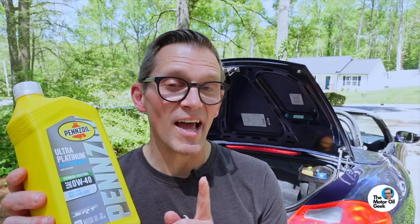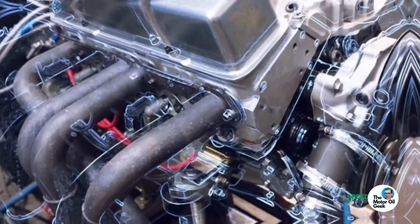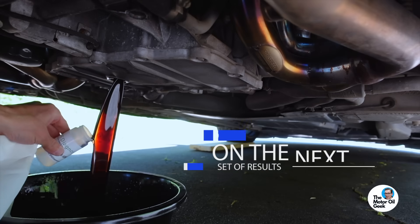Esters are typically good because they have polarity and lubricity, but that polarity can compete against the additive package. I'm really glad I chose the Pennzoil Ultra Platinum 0W40 because I want to see what the higher level of moly and this GTL does. Before, Pennzoil would never sell the GTL base oil on the market for other blenders to use, so I've heard rumors about how good it is — I want to see it for myself. From the 5W30 it seemed to be holding pretty good, at least for that first sample, so I'm curious to see how this less-is-more approach plays out.